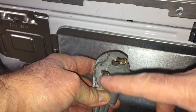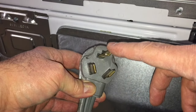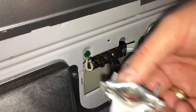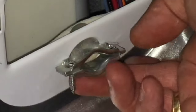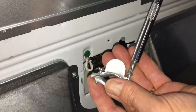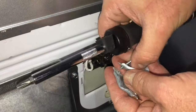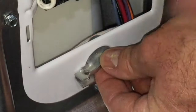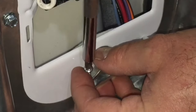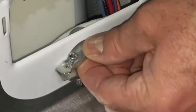Here are the hot terminals and the one in the middle is your neutral terminal. Now I need to install the cord keeper. It goes into the hole where the cord slips through. It's a pretty important little gadget in that it prevents any pulling or tugging on the cords where they are attached on the inside of the dryer to the electrical terminals, where any excessive pulling could result in a short or a fire. It also prevents that thin piece of sheet metal from cutting through your cord. It's 95 cents or so, not that much, and it doesn't take long at all to install. So you break it into two parts, fit the top and bottom through the slot, and tighten it down a little bit but not all the way because you still need to thread the cord through. That little piece of white felt prevents dust from getting back to where your electrical connections are.